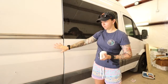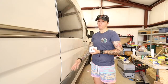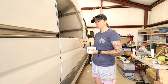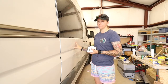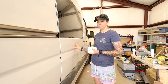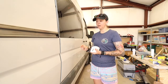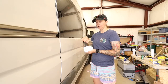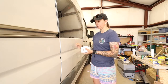So we're going to decide where to put it and then drill it in. If you have to put it below the rail, the first thing you have to consider is the paneling on the inside of your sliding door. If you've replaced the stock paneling with a thicker piece of wood, you have to make sure that when you open the door to slide it, it's going to clear the lock. A lot of people use really thick wood and the door will only open halfway before it rubs on that panel.